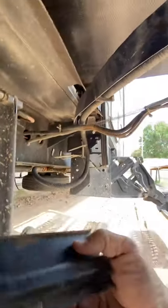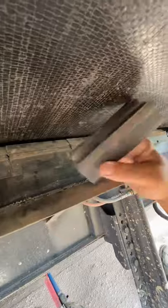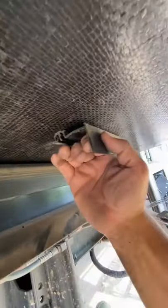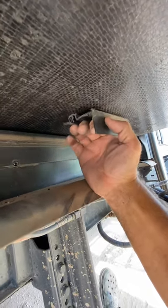On your slide out, all it does is rest on — forgive me, I can't remember what they call this black stuff — and I've already cut out this piece right here. That sits in there like that, and that's all that it rides on. So this is stationary in there, and as the coach goes in and out it just rubs on that. When it's brand new it's fine, but after a few years with dirt and everything it starts scuffing that up. It usually starts worse on the edges, and you can see down there on this edge where it's doing the same.